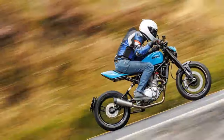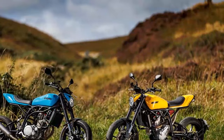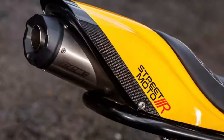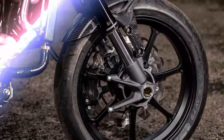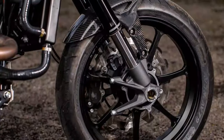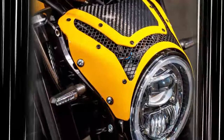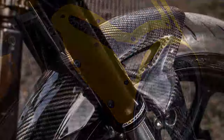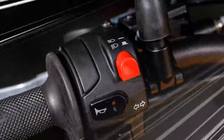It's worth noting that while all CCMs use the same engine and throttle body design, they have subtly different power characteristics thanks to exhaust layout. The Street Moto's low-level exhaust has slightly smaller bore pipework than the Street Moto R's high-level system, necessitated by the need to maintain ground clearance, as a fat header would have limited clearance. So it's fractionally down on power and torque, although the precise difference isn't stated by CCM. But it's also softer at the first touch of the throttle and smoother throughout. If you're not fussed about giving it big handfuls, the base model is the nicer bike at slow to moderate speeds. But you'll want the Street Moto R for really having fun — just the slightest touch of snatchiness and a slight increase in vibes is made up for by a freer-revving and friskier feel, particularly at higher RPM where the larger pipework doesn't hold the motor back like the underslung header.